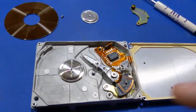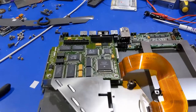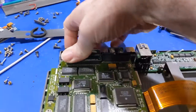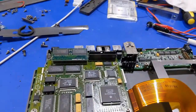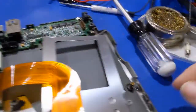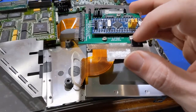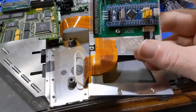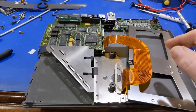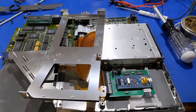I'm going to scrap the drive — it's pretty much junk — and we're going to move on to the BlueScsi. I got the screws back in here for the CPU card. Now I'm going to put the RAM in and hope this RAM is good. The next thing is to put the floppy drive back in place. I've got an SD card with two images on it: the Apple Legacy CD and a blank 1700-megabyte image. Let's finish getting this thing put back together. I got the floppy drive and BlueScsi mounted in.